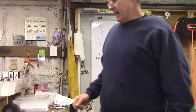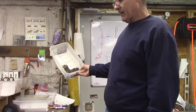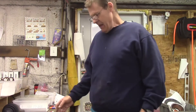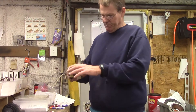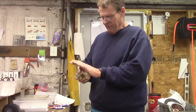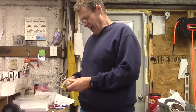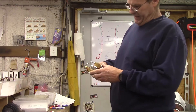Really only made in '70 and '71, and then with the muscle car crunch and all that era, they started getting cheap and went to this cast-iron thing, which is horrible. Everybody knows what cast iron does — it pits up and rusts when it's been sitting. But this brass valve, last of the brass valves, this bad boy is gonna last you forever unless you really abuse the hell out of it.